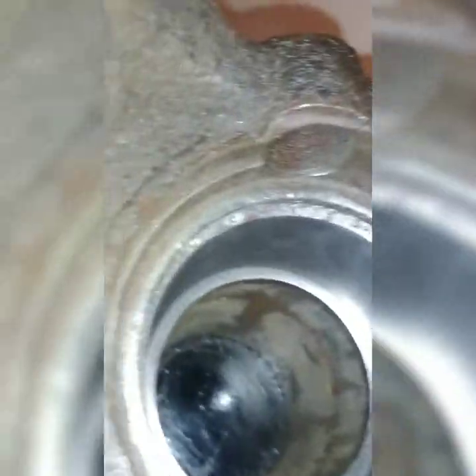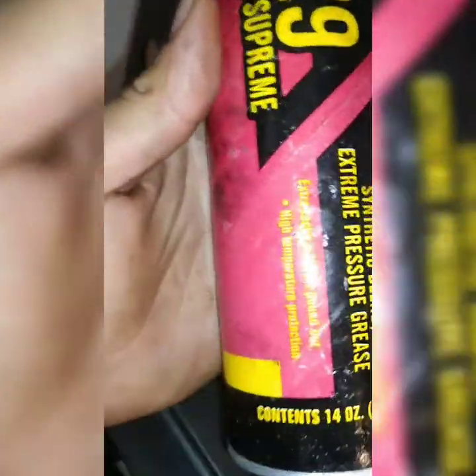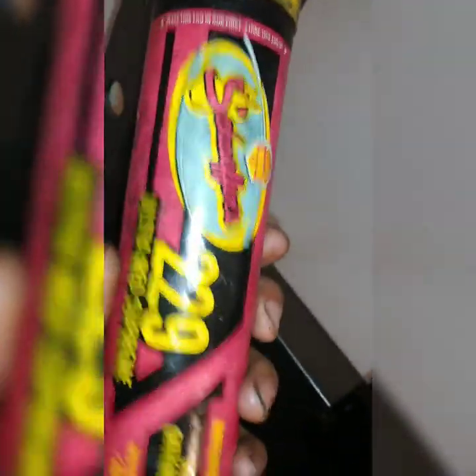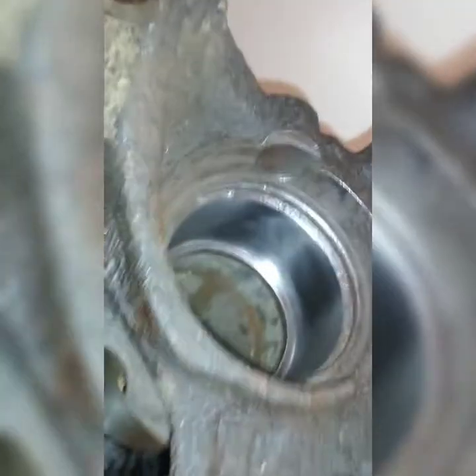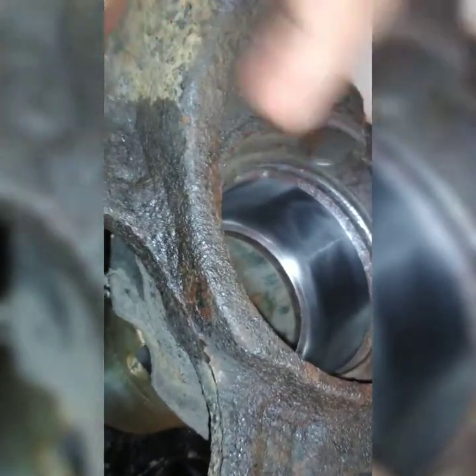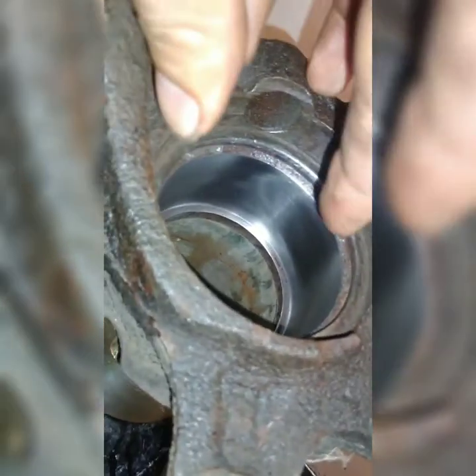Now, as you can see, I got it clean. I'm going to put some extra tacky, won't-pound-out, high temperature protection grease — Schaefer's, because I am a Schaefer retailer. I'll be caking it up all over the place, all the way up to the snap ring, and I'll be pushing that bearing in in a linear way.